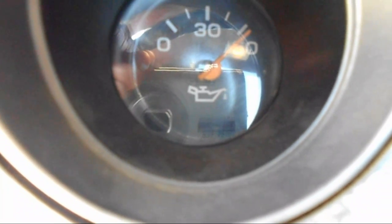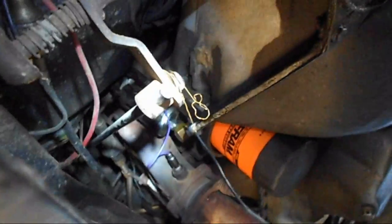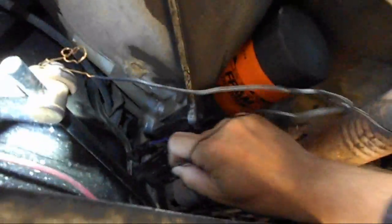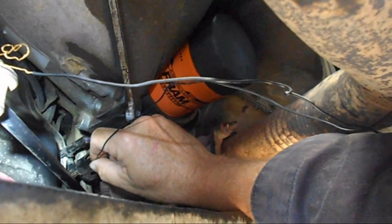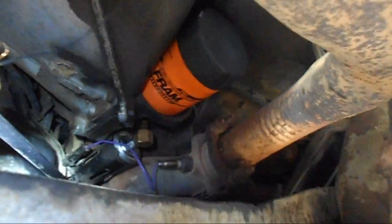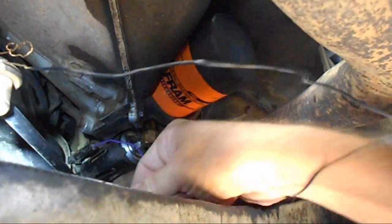So that's one sign. Now the next test is the grounding test. Make sure you securely ground a wire — hopefully that's a good ground — and then you're going to connect it to the connector up in there. Hopefully it'll stick in there so you can go back into the cab and check it. The meter should be pegged all the way to zero.